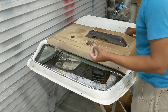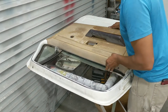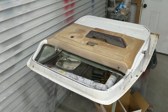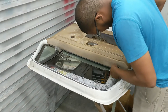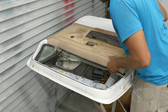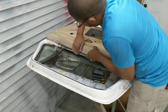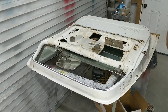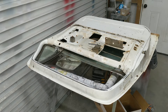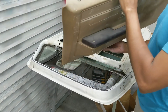Make sure you remove your door plunger for your lock. Lift up on the bottom and slide it this way — see if we can get her up off here without breaking anything. That's the critical part — without breaking anything. Inside the door panel looks good, doesn't look too bad at all. Felt's in good shape.